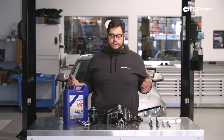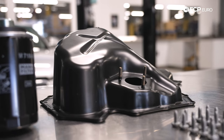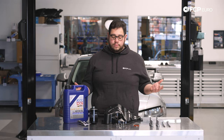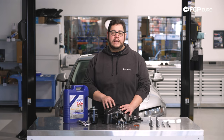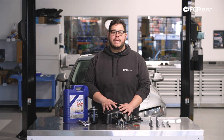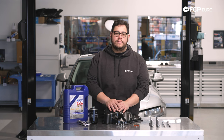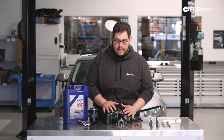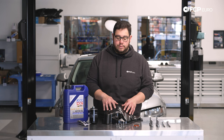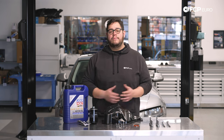A couple of reasons why you might want to do this. One, it could just be leaking — these are glued onto the block and over time that seal can fail. Two, which is pretty common with the cars we see up here where we live, is the pan actually starts to rust out. That's the case on the B8 behind us. It's pretty rusty and it almost looks like you can just poke your finger through the pan, so we're going to go ahead and replace that today. If you're not replacing your pan and you're just looking to reseal it, this DIY will also be applicable.